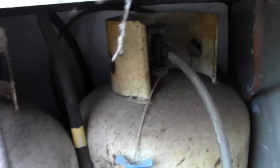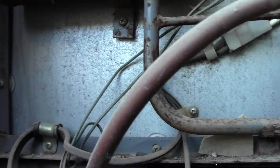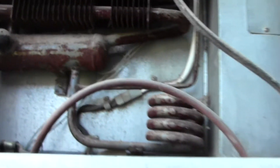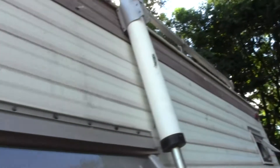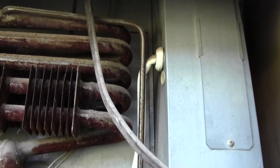Not sure if they leak but you never know. I think this fridge is just straight LP - I'm not seeing a compressor on it anywhere, so if that's the case it's got to go, unless anybody can tell me different by looking at it here. But I'm not seeing a compressor at all. So if it's not, I'm going to pull it out and put a regular plug-in fridge in because there's a plug-in up behind here.